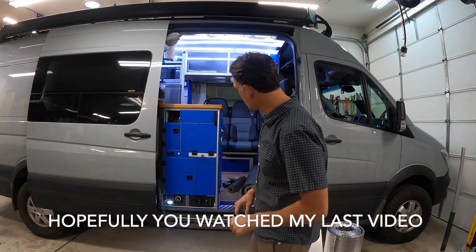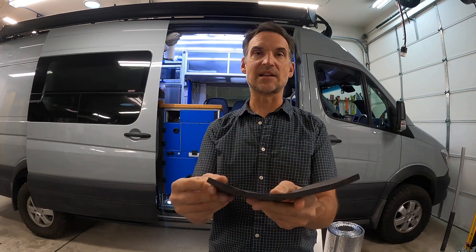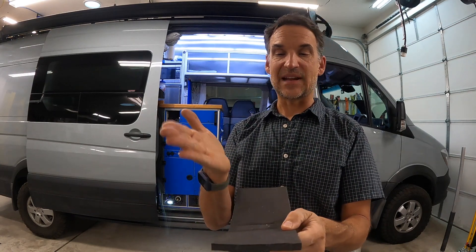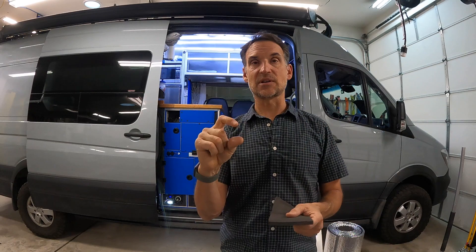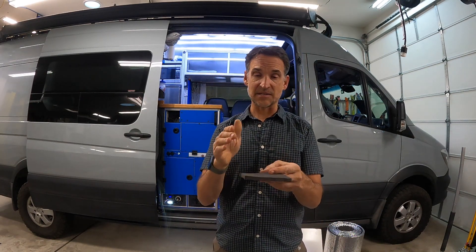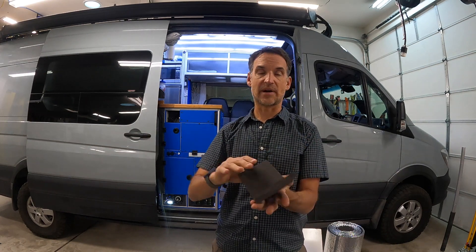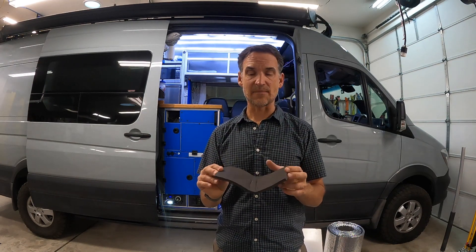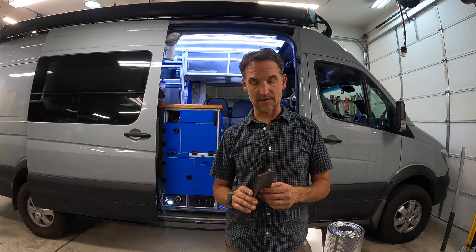Those are the walls. This right here is the 3/8-inch mini cell foam I used. It also comes in rolls — you can cut it to sheets or buy pre-cut sheets for certain van models. I cut it for the floors, even making angle cuts to maximize coverage in those troughs. I bought 3/8-inch because the floor troughs are actually 3/8 inches tall, which pretty much fills them in. I then used another sheet to go right over the top, so you just buy one big roll. Six-eighths — three-quarters of an inch over the floor, plus the subfloor and finish floor, just wasn't enough.